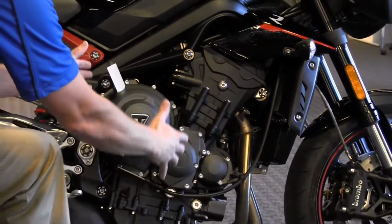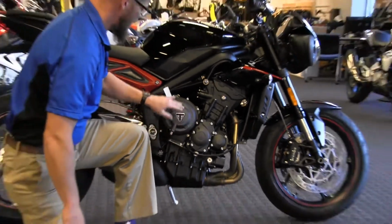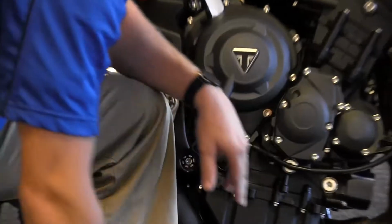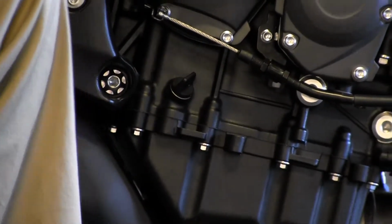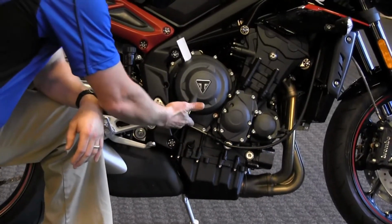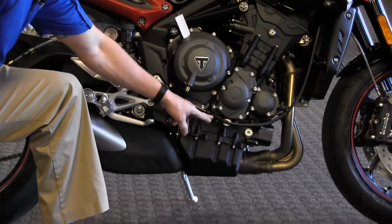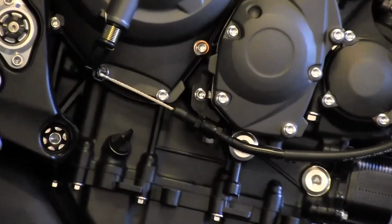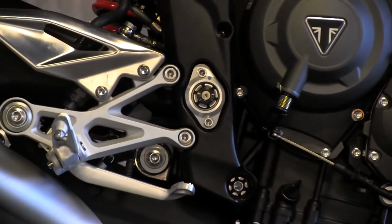We have a one-piece engine transmission that's very compact and stacked. So we're going to have our oil fill, our oil check, an oil recirculation system, and on the other side, our spin-on filter with a drain obviously on the bottom. Our clutch cable right here is going to be adjustable for major adjustments right here for our clutch actuation rod.